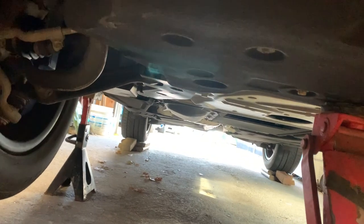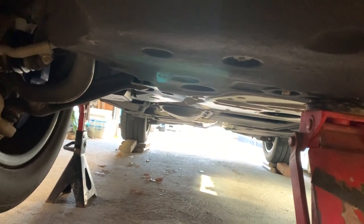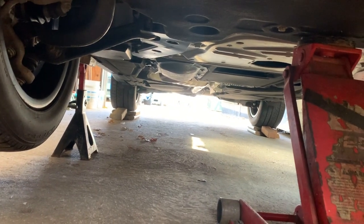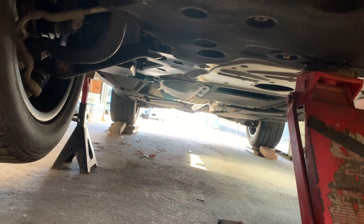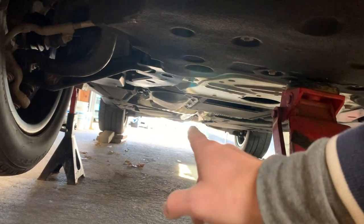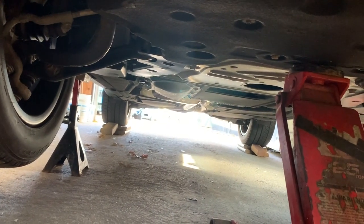And the rear wheels, I actually put some flat small ramps I made. I drove the rear wheels onto them, because you want the rear of the car to be higher as well, because you're gonna be working in the middle section as well over there. So you want to have some ample room.